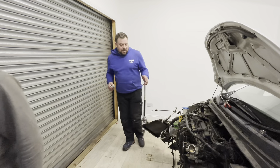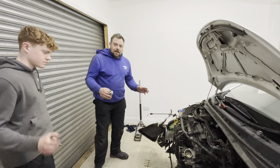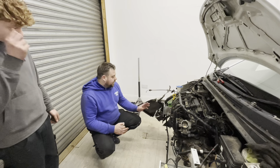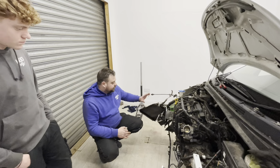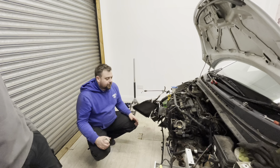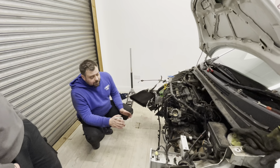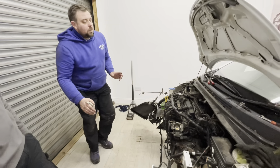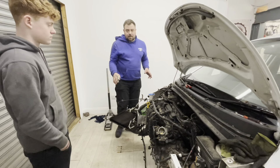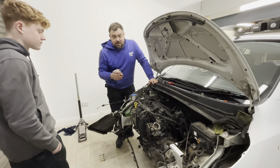Right guys, we've spent about an hour doing all the boring stuff. We've taken the radiator out, drained the coolant. I've managed to keep the aircon in one piece — unbolted the pump and moved the condenser to the side. The front core support's off, I've undone all the gear cables and the clutch cable. Now we're at the point where Charlie gets hands on — this is where he starts getting involved with stuff he's never really done by himself.